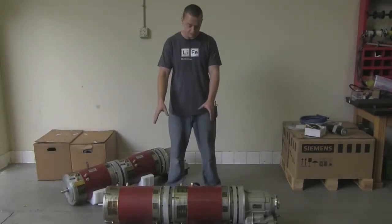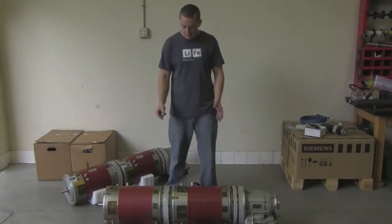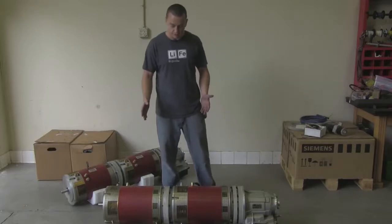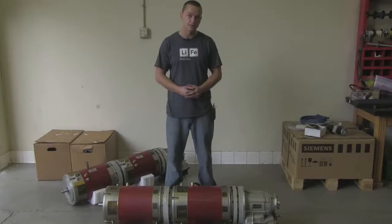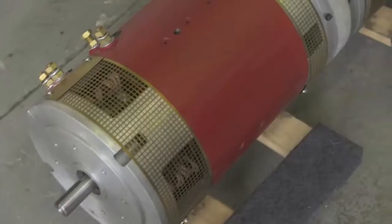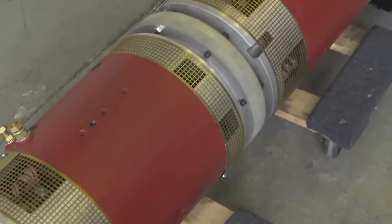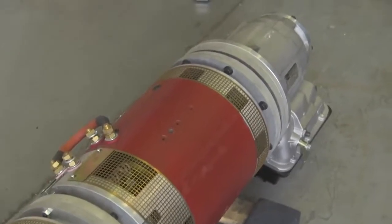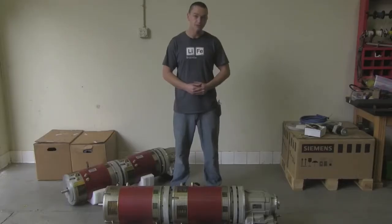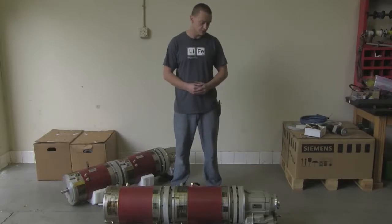We have two 11s, which are capable of 1,000 to 1,200 foot-pounds of torque between them, and you can expect anywhere from 400 to 600 horsepower depending on voltage sag. Overall length of the whole package is 54 inches. On the back we have our two-speed PowerGlide — you can get this in a 1.76 ratio first or a 1.82, and second gear is direct, so just one-to-one straight through.